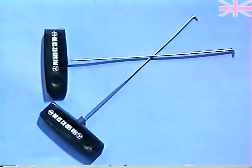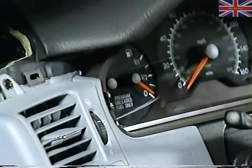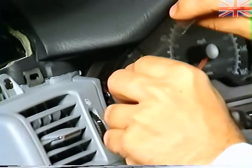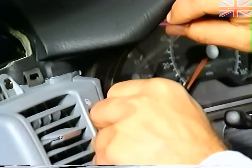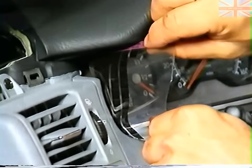Pulling the instrument cluster is the next operation, and the previous pulling hooks apply to the Model 210. Be sure that the pulling hooks engage the slots in the cluster housing to prevent damage to the cluster. Here's a good hint that would apply to all models. Before removing the instrument cluster using the pulling hooks, insert an old microfiche to protect the instrument panel.